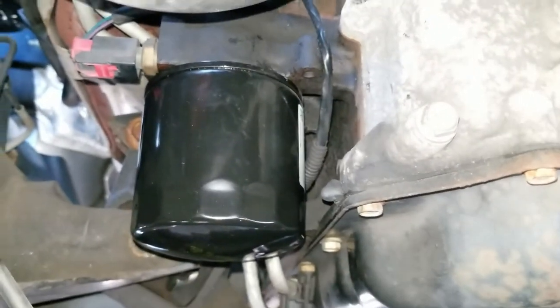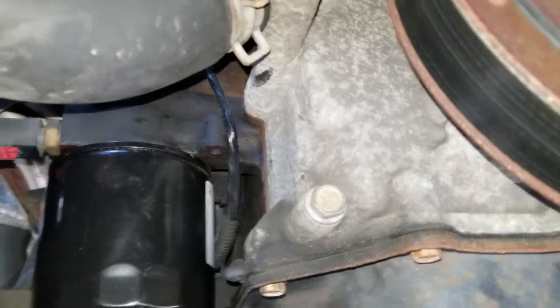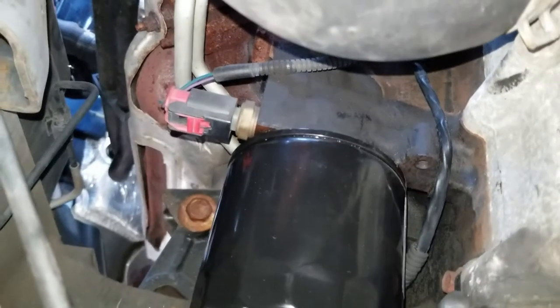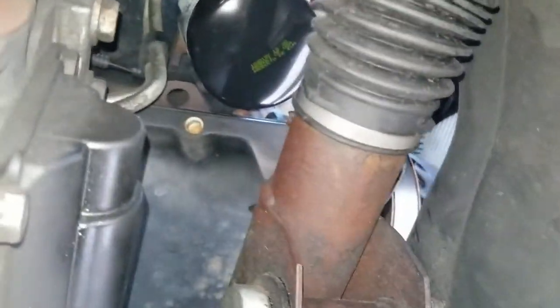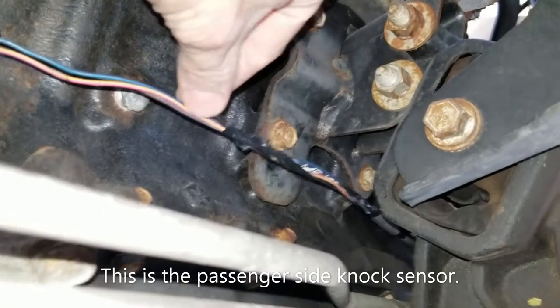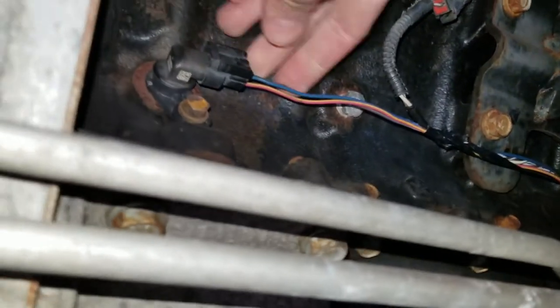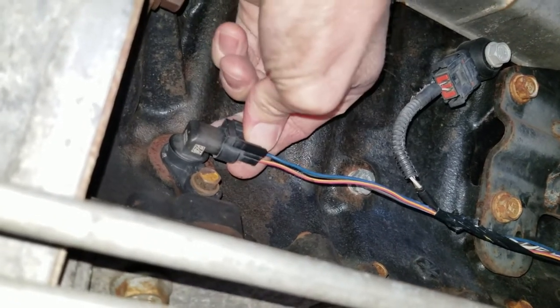The good news is it looks like if I take the oil filter out, I can probably get pretty good access. I think if I disconnect some of these sensors, I can probably pull the harness out and access it from the top side of the engine. I'm going to have to disconnect what's probably the oil temp sensor there, and then there was another connector back here — I'm not sure what that sensor is, but that's in that same part of the harness. And of course I'll have to disconnect the crank sensor. All these have squeeze connectors, so just squeeze with your thumb and fingers and it should slide off.